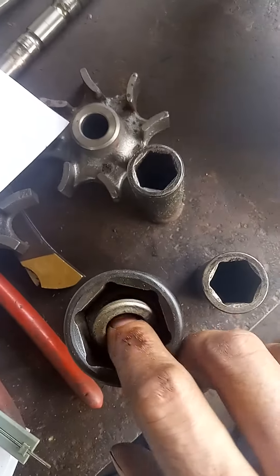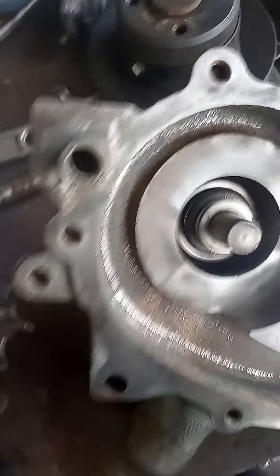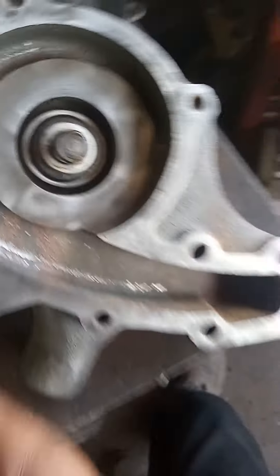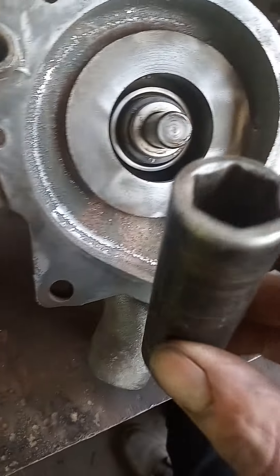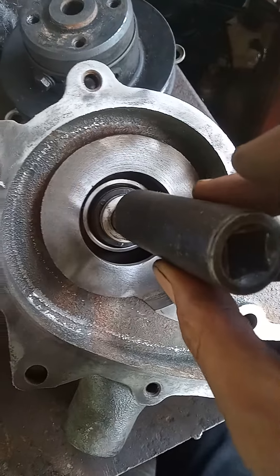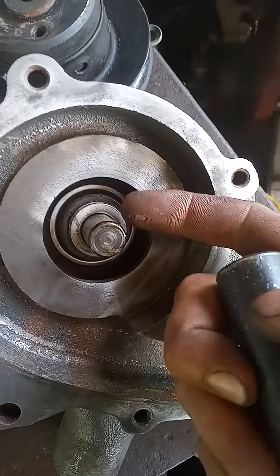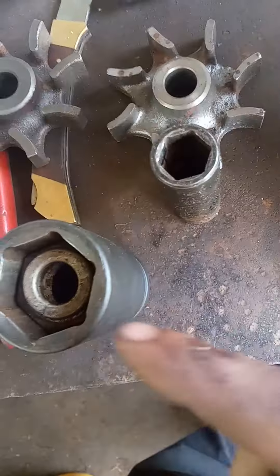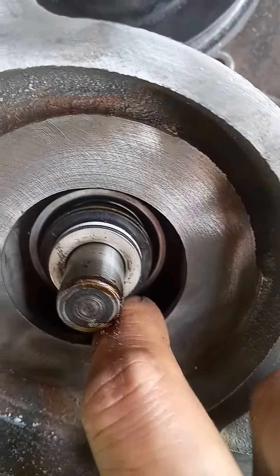That slides over your shaft. What you want to do is set your seal on the shaft, take a 17mm or any socket big enough to go over it, start the center part of the seal down and get it down on the shaft enough to center everything up, but not far enough for the bottom part of the seal to start going into the seat.